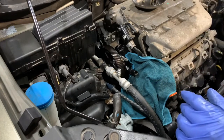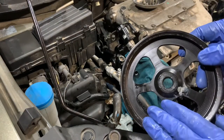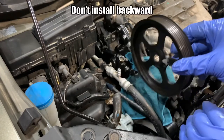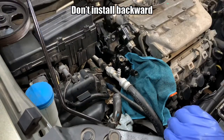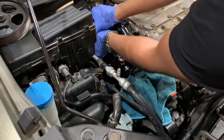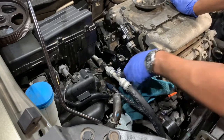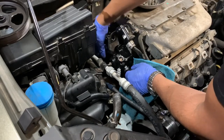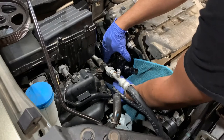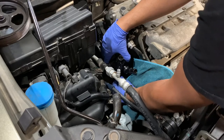That's the 19mm. One thing to remember — pay attention to the pulley when you're pulling it out. The flat surface goes outside. The part that sticks out with the spline in it goes on the inside, so this will go in that way.